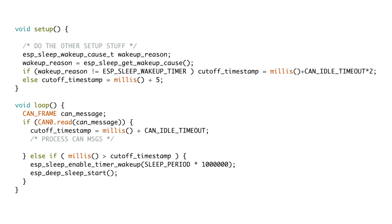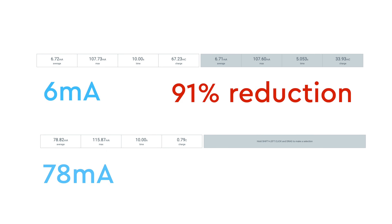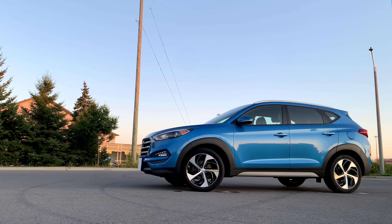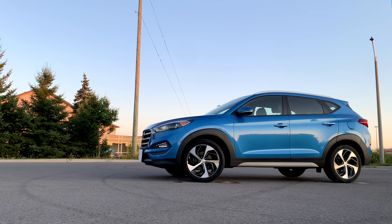I needed a solution. First I tried a software-based fix: I kept an eye on the CAN bus and if I didn't see any action for a while, I put the ESP32 in deep sleep, then woke it up, checked for messages, and put it back to sleep — rinse and repeat until I spotted some action. This little trick easily cut down energy consumption by more than 90% compared to doing nothing, as the majority of the time the ESP32 is simply in deep sleep.